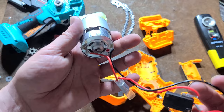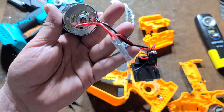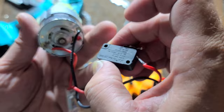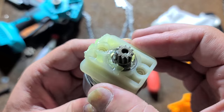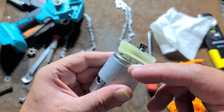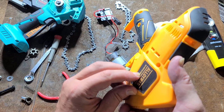The only protection that this thing has is if you run it too hard, this is a little thermal switch. What ends up happening is you run it too hard, the thermal switch will overheat and cut out. Then over time it will cool off, re-engage, and then you can use it again. It's just using a simple off-the-shelf micro switch — it is a real basic design. The grease is clear — it doesn't even look like lithium grease; it looks like whale fat. They put a ball bearing in the support and this is just machined for the gear that's press-fit over the motor arbor. You have to use a gear puller to pull this off, and they still have the normal sleeve bearing in the motor — they're just doing that to add extra support because the sleeve bearing would probably destroy itself under the kind of loads a chainsaw would put on it.